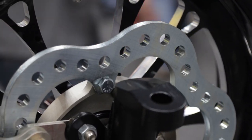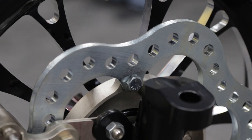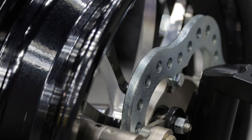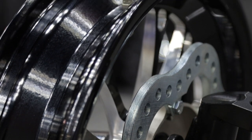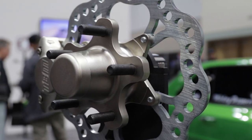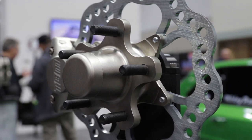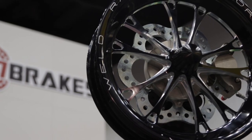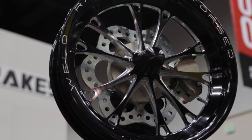Speaking of the rotors, there's some very interesting engineering going on here — a lot of features you don't normally see on brake rotors. This is our Revolution rotor. We developed this shape about 20 years ago for the sprint car industry where weight is critical. We realized we could have a lighter weight rotor that lasted longer and stayed flat. These rotors will last two years on the back of a sprint car, and that's where our confidence comes from for their life on the front of a drag car.